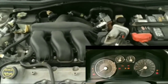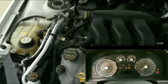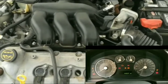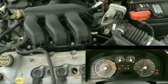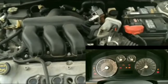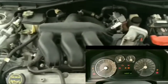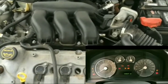So what I did was I did open the hood up, obviously. Before I got it jumped, I was doing a couple of things. I checked to see whether the terminals were rusted or had any kind of debris on it. It was kind of dirty. I did unscrew the connections to the terminal and clean that up a little bit with paper towel. I tried to wipe some of it off. I sprayed some WD-40 on it and tried to wipe some of it off.